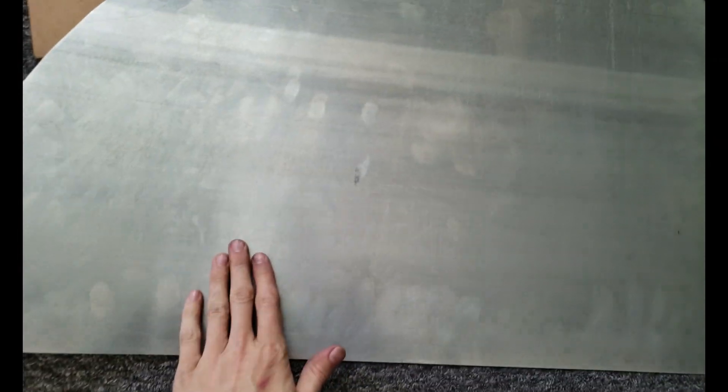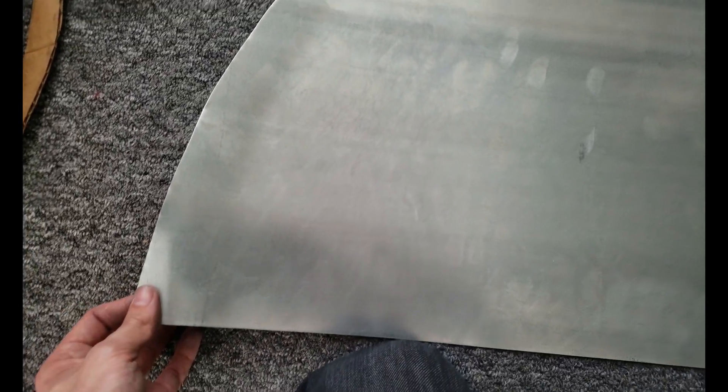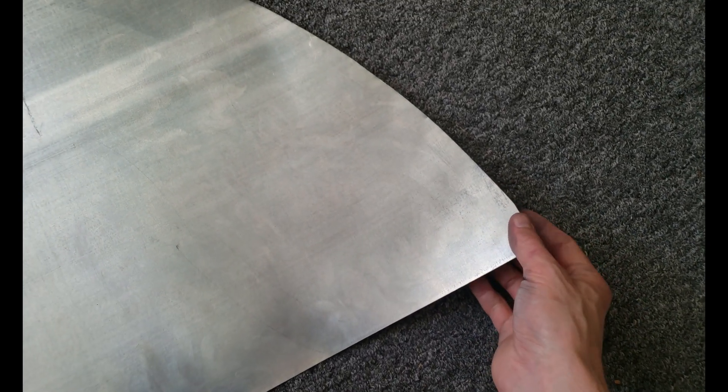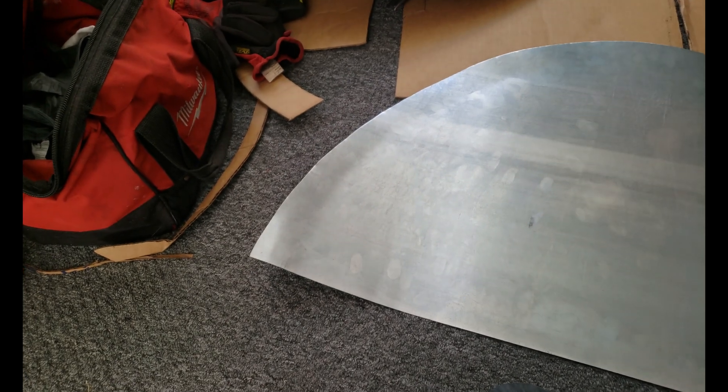I gave this thing a pretty basic bend — did the main bend here, and then kind of did that along these areas to make it conform a little bit better to the edge of the car. It's sheet metal so it'll stretch a little bit, which is a good thing for what we're doing. I got a little tab down here for the back side. I might take a screw and screw it through there into that plastic trim on the bottom — maybe even a nut and a bolt. The top will be pretty much flat, and the front side wraps around pretty steep to a little under-edge of the car.